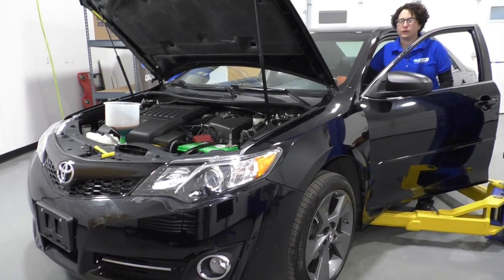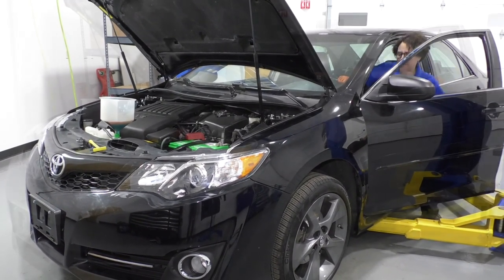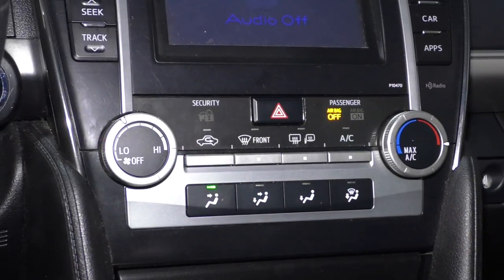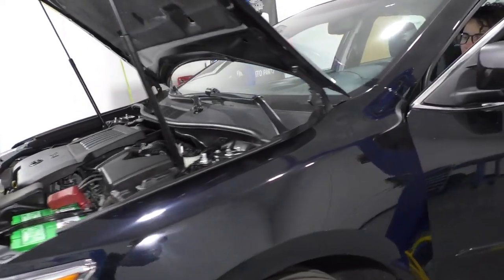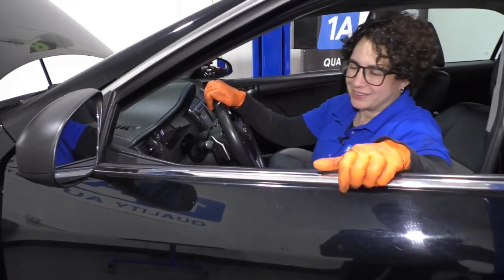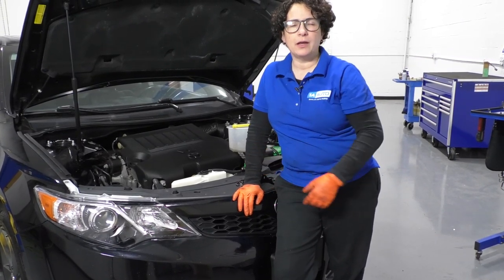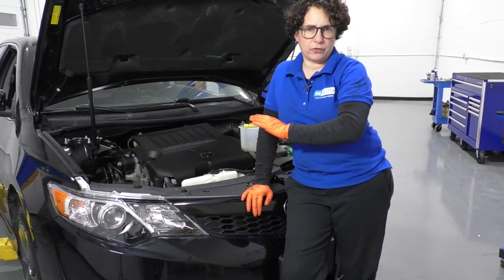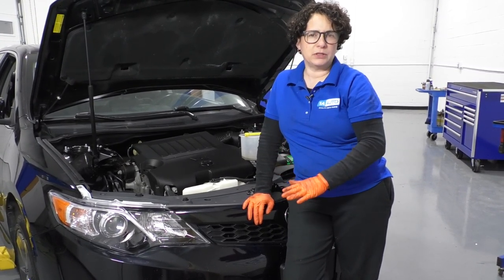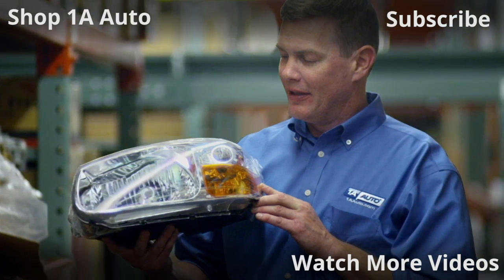Good to go. Now we're ready to run our vehicle and let the coolant burp using the overflow fill tank coolant burping tool. Run this with the heat on max vent and AC off — you can turn the blower on just a little. We want the hot coolant to circulate through the heater core to get the proper level. After about 45 to 50 minutes, that should be full temperature for this car. Make sure you hear the coolant fans come on — that's a good indication the PCM is getting the proper signal from the ECT sensor, that your thermostat's working and the coolant's full. If you enjoyed this video, please click the subscribe button.